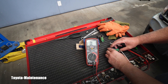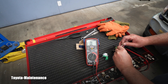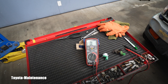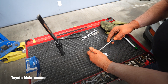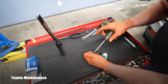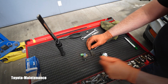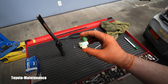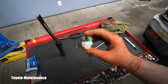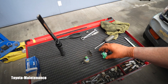Do you hear that? This valve clicks. The other one is dead — it doesn't do anything. I'm touching it — dead as a door nail. What's left to be done is transfer the bracket. I'm glad the Phillips screws moved — sometimes they're super tight due to rust, but this one moved fine. The Toyota part number is 90910-12065.